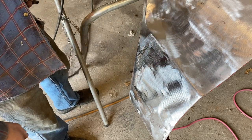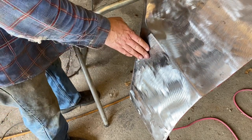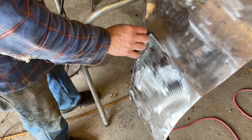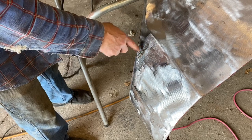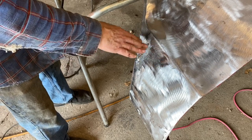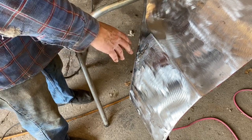I'm not saying it can't be done, but in general, you're much better using a MIG where you've got a cut like this. So now this is very cool, it's in position, and I know the heat, when I start welding on this a little bit, it's gonna still move around, but I wanna try to fill the rest of these little spots in here, and then we'll let it cool, and then there'll be probably three more attempts like that to fill that in.